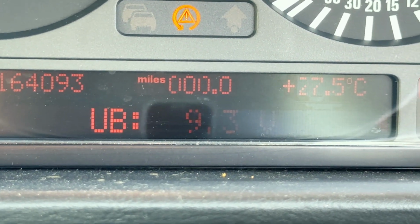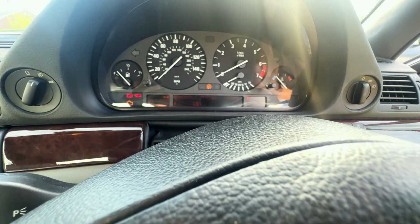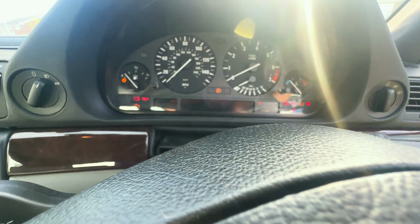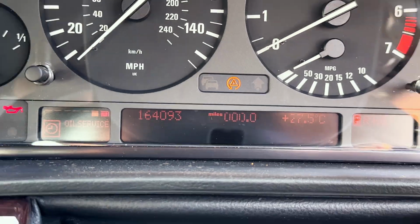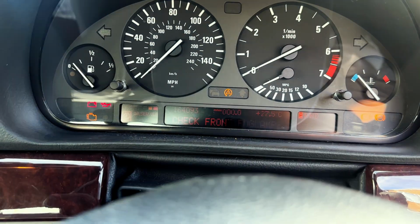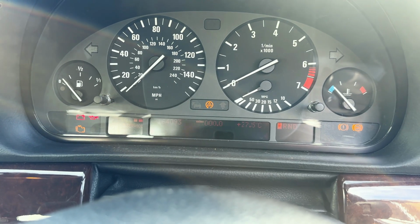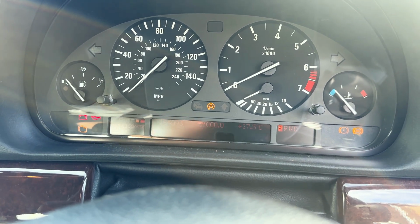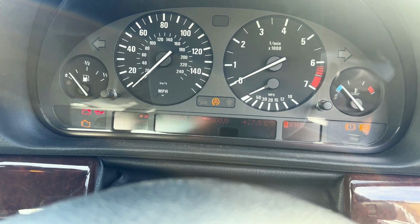It's showing 9.3 volts. However, if I start it up, hopefully if it does start up, no, it's not got enough power at the minute, but once it's started up, it should show up to 14 volts to say that your battery is charging, and it will show your static battery as well with the car off, so it should be showing just above 12 volts. So these are 2 examples of the features that you can see in this hidden menu. However, I'm going to put a full list that I mentioned before in the description below for you guys to use, and hopefully you find it useful.